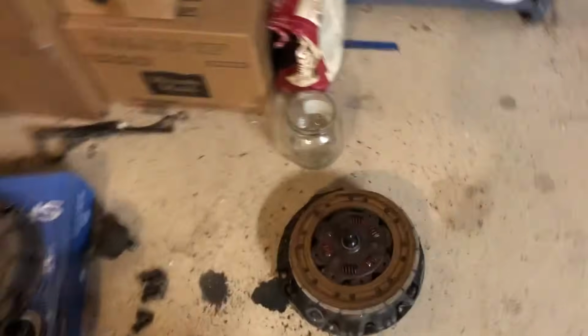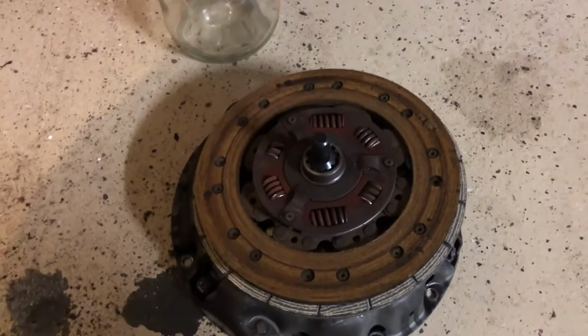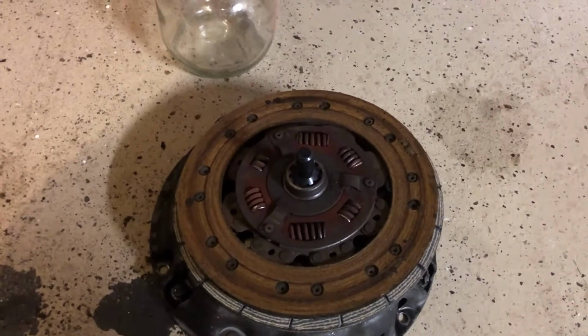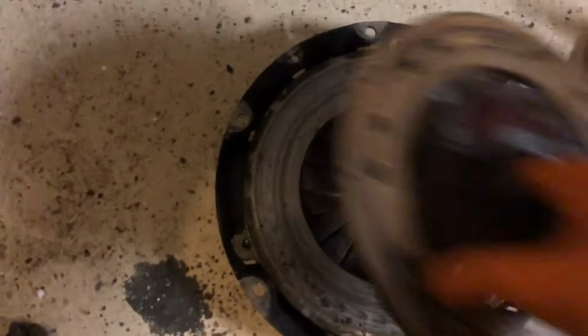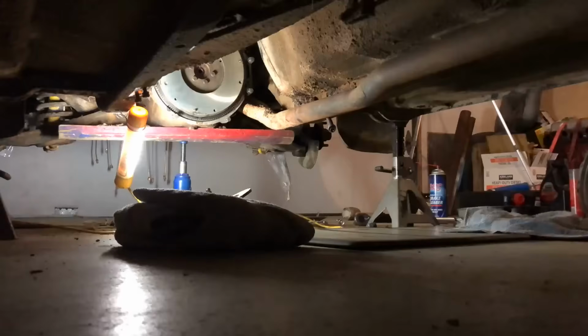I think somebody's put in the wrong clutch in here. We know that 20 millimeters is the difference between the B18, B20 clutches and the B30 clutch. So that disc in there, this is the old pressure plate, and sure enough, it's only taking up partial engagement. Clearly it'll work, but it ain't right. And now we're gonna go right.